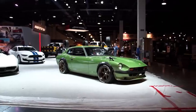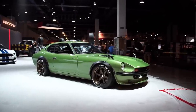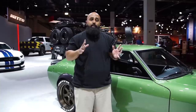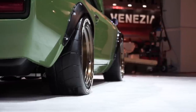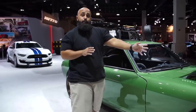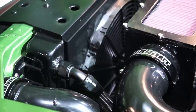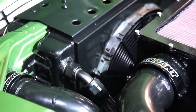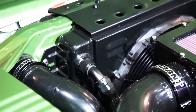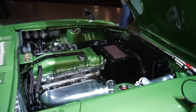It is a very era-specific, beautifully done car that's meant to complement and not change the body lines, but don't get mistaken — this is a full-blown race car. Great nimble performance, very well balanced, and it's using an S14 SR20 fully built power plant. It's a Garrett GT3071 turbo using all Vibrant Performance AN plumbing, tight radius elbows and HD clamps, and a variety of other accessories needed to make this car what it is.